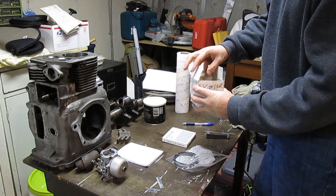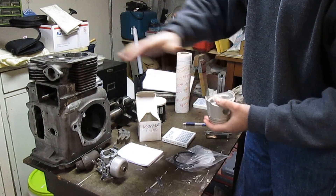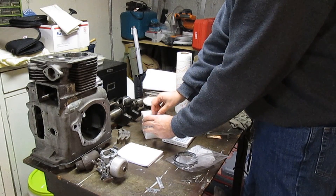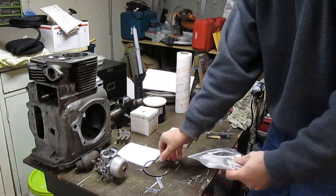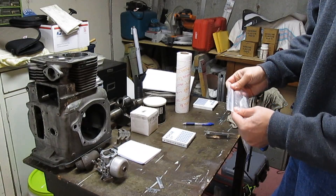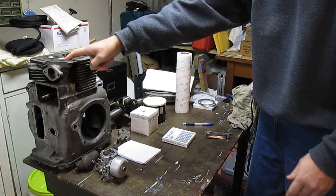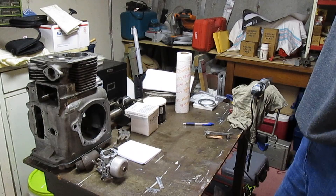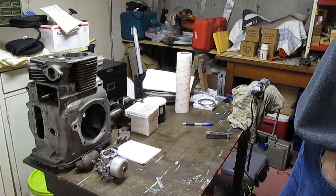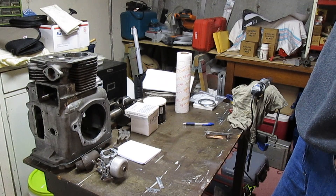One thing I do is make sure that you use the piston when you do your measuring — use your piston to push it into the bore so that way you know it's nice and level and you're going to get an accurate reading. So there it is, that's how I end gap rings. It's kind of backwards but it works. With a fairly tight ring set, good valve seats reground, and new valves in it, this thing should have factory killer compression. And with that, let's watch me ruin a set of rings — just kidding — we're going to end gap the rings right now.